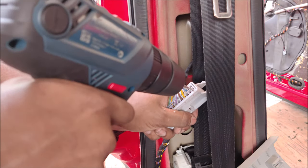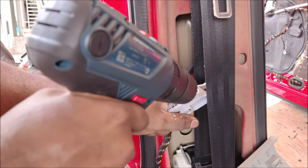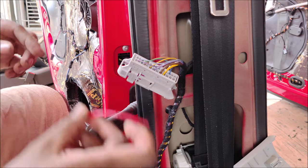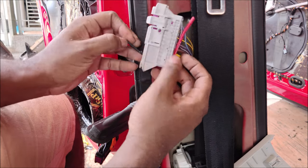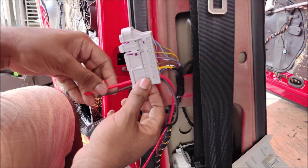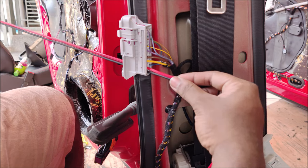I was hesitant but had no other choice. My initial plan was to feed the wires from the amplifier through the head unit using the original manufacturer wiring, but the wires are too small for a powerful amplifier — they'd heat up and that's not a good scenario. So what I did was drill a slightly bigger hole and then fish the connector harness through it. It's easier than stripping wires at the head unit and far less risky at the center console.